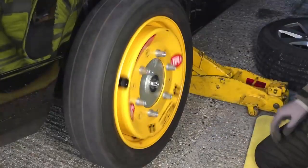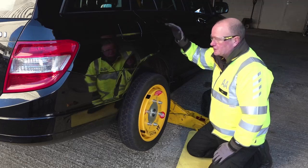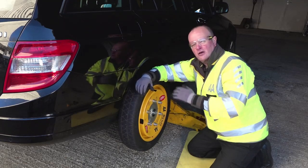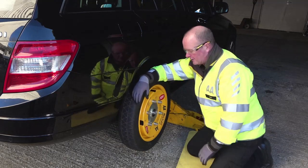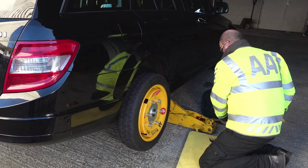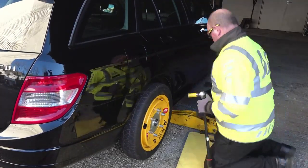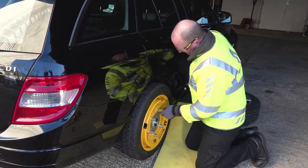Once the wheel's on, it's the usual check for clearance, looking for any fouling of brake calipers etc., and we're ready to drop down. On this car in this setup the other wheel's on the floor and this wheel's raised, so the handbrake's on — lower it down. At the roadside when you fit two of these, there's an issue of the vehicle moving away, so that'll get covered in your training. On the other side of the car would be your conventional multi-fit wheel, but we are going to give you the same nuts as these, so they're much more durable and can be used with the DeWalt gun. So let's drop it down and do the final torque of the wheel nuts.